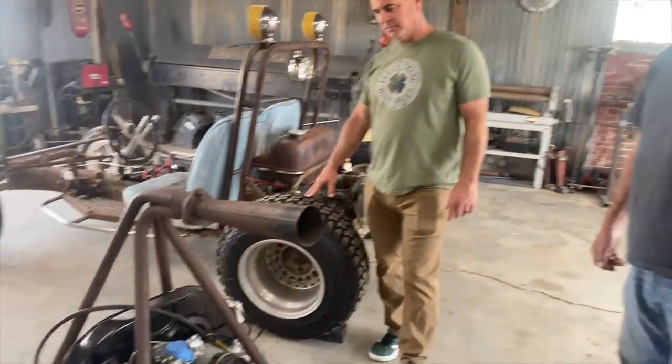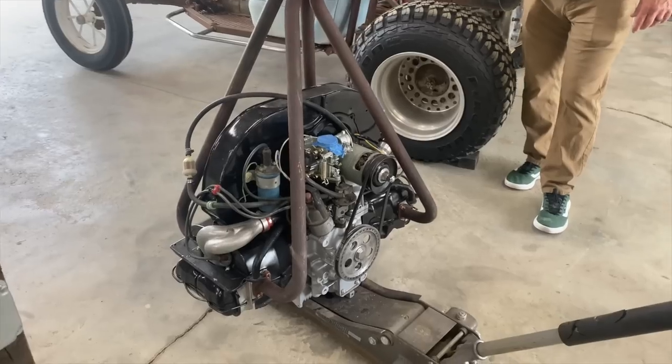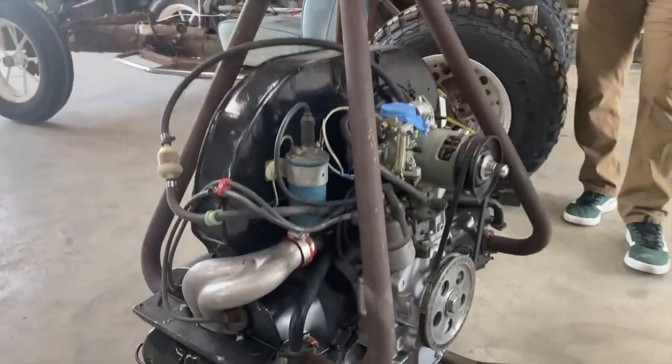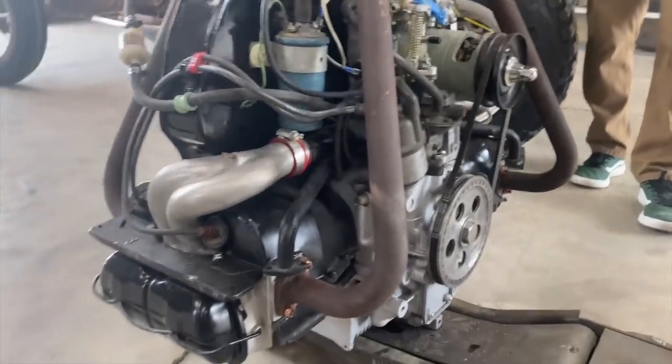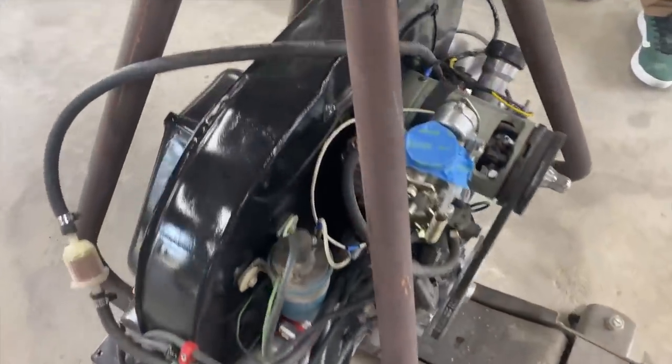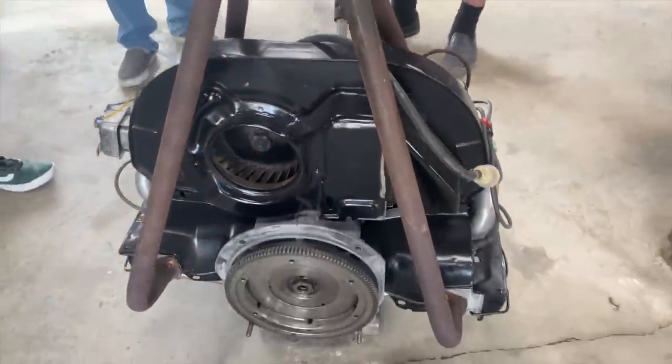We finally — I say finally because I've been so busy — Barry and Jeff have done the complete restoration rebuild of the Volkswagen pan tunnel buggy engine. It's bumped up a little bit in displacement. Barry said it's a 1641. It's all new stuff — pistons, cylinders, heads — and Barry went through and checked the bearings, etc., and everything inside was pretty decent.